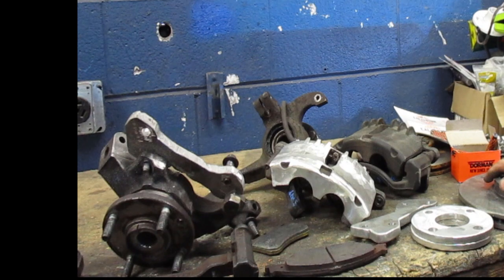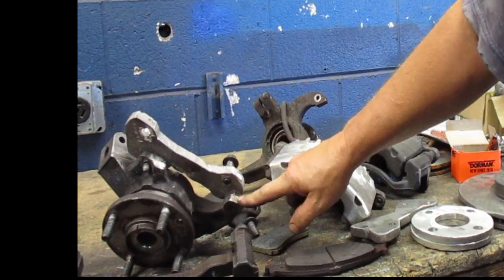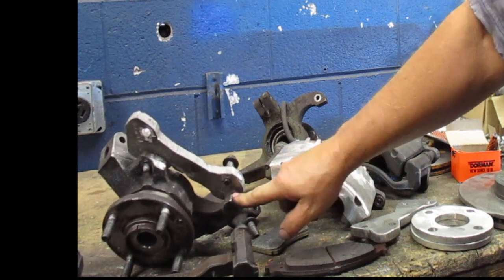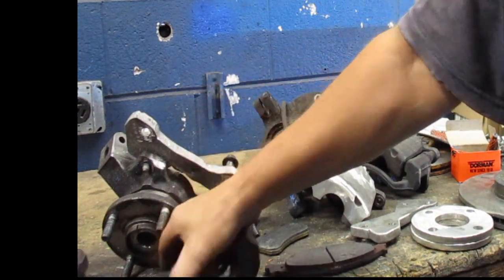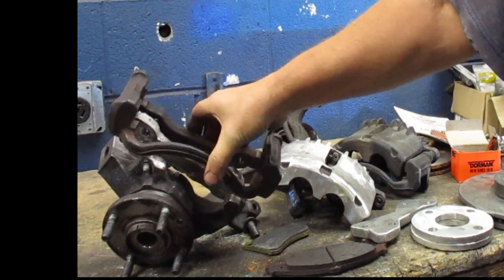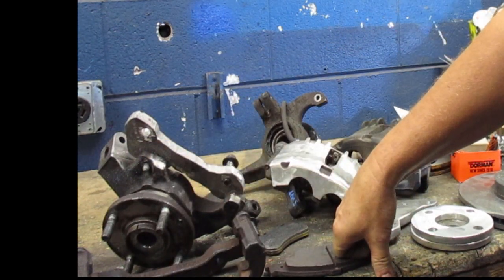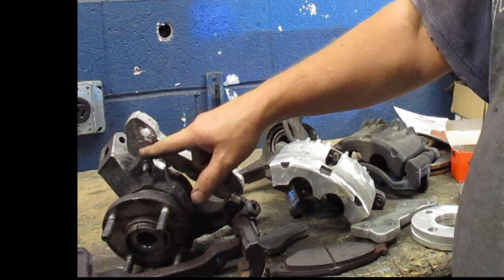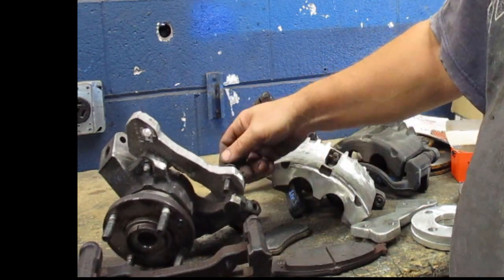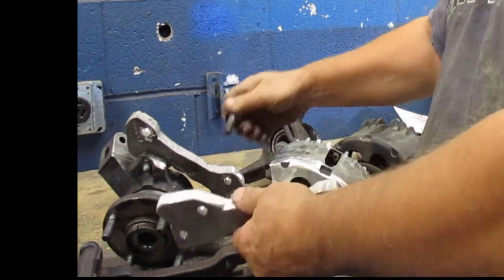The key to doing this is: you have to cut off the stock mounting ear, position the caliper mounting to see where it needs to be, then cut that part off and leave enough material to grind it down to just the right size. It's not a critical dimension except that the adapter plate must not be sloppy — that's why I redid this one.